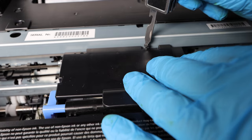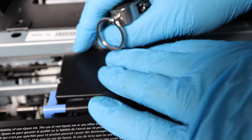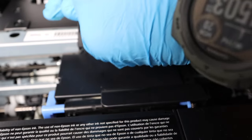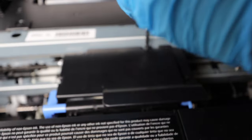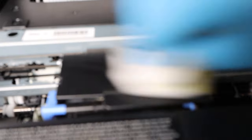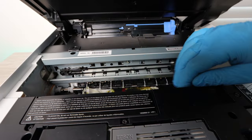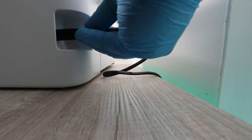This is not where it ends — the instruction continues and you have to follow the rest of the steps in this video. Now I'm replacing the printhead cover and screwing in the two Phillips screws. Make sure you have the proper tools. Once everything is put back together and you've removed the paper towel from under the printhead, you're going to close everything up and plug the power cord back in and turn the printer on.